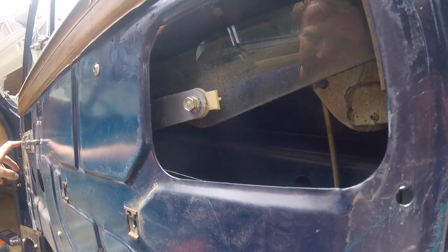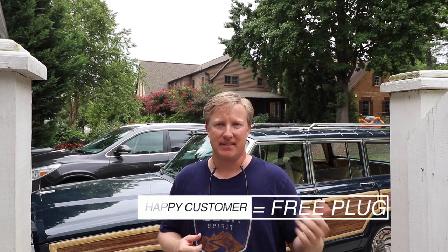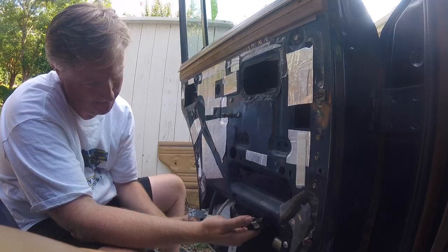Hey guys, on today's episode of My Jeep and Me, we're going to be taking a look at the windows, which is a common problem on the Jeep. One of the things I've started to do is, as each window flex track breaks, I'm upgrading to the 1991 version which had a metal track — the J-track that goes up and down as metal and shouldn't break, where those flex tracks, the plastic little teeth snap off. I will say I've tried a lot of different brands; probably my favorite is the one I get from BJ's Off-Road — not a sponsor of the show, but a good place to source parts. So let's dive into these windows right now.